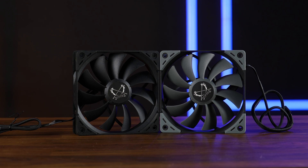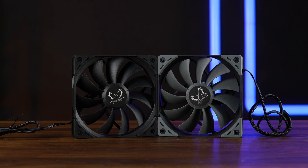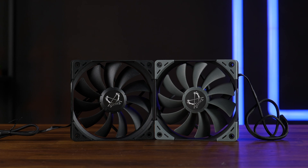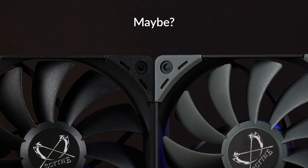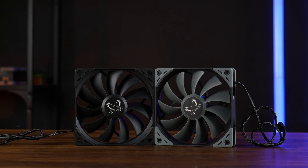Compared to the previous model, there are relatively small generational changes. Scythe seems to have played a bit with the fan blade design. We still have that 11-blade design, which is a ridiculously large amount given what everybody else is doing. It seems the angle has very slightly shifted, and that paired with other miniature changes gives the Flex 2 slightly more CFM at the cost of a tiny bit of static pressure.